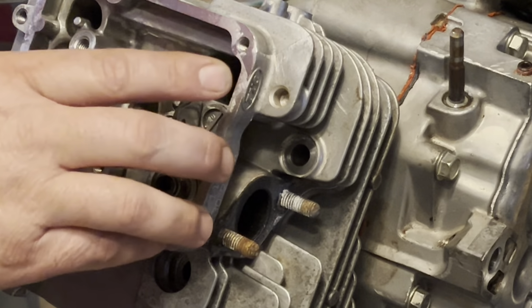Okay, here we are. I did have to put the belt back on, the deck belt, I forgot. Anyways, I did fill it with oil, I failed to mention that. I just filled it to the full mark, which got a new filter on it, so it's gonna have to be topped off. But anywho, she's got plenty to start, I know that. I'm gonna start it, let it run for about 30 seconds, and I'll shut it off, and depending on what it does, there's a chance that governor may just run wild with us.